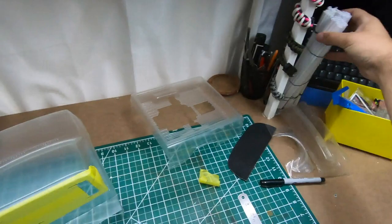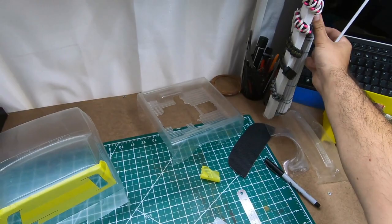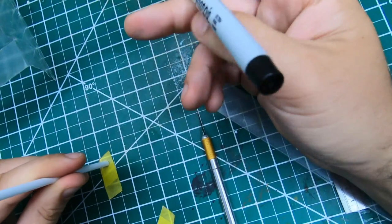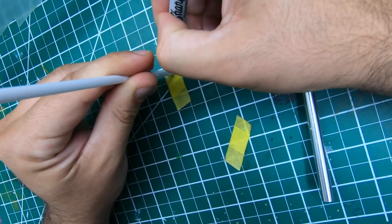So, reaching for the 3/16 of an inch polystyrene tubing, we're just going to ensure that the roll cage exit has enough material to accommodate the size of the tubing and allow it for a free exit. You're going to see me just mark up the top and bottom of the tubing to leave myself a little bit of meat right there on the outside of the Lexan to send some body screws through.